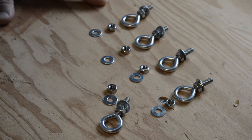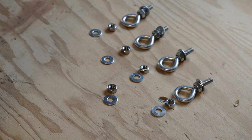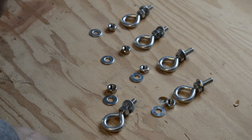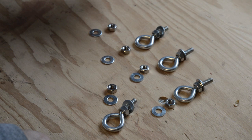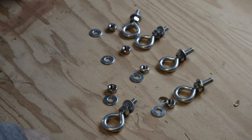One of the things I should have done with the trailer when I first put it together was to put some tie-down points on it for the bungee cords — we bungee down a tarp. I got some quarter-inch eye bolts with some washers and nuts, and we're just going to bolt those onto the frame. You could probably go up to three-eighths inch, but you'd need a bigger washer, like a fender washer. I'm not tying down a motorcycle, just tying down tarps so I don't blow leaves all over the highway.